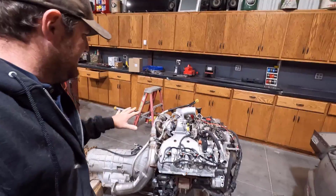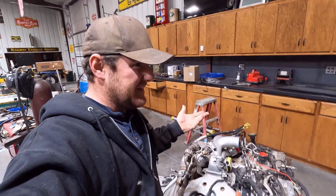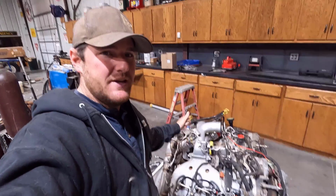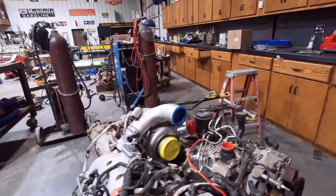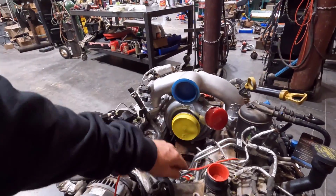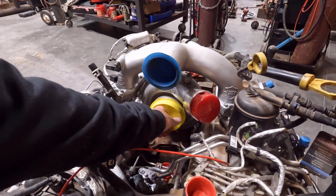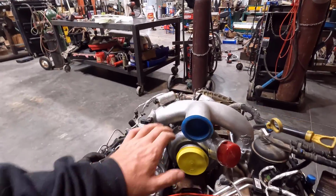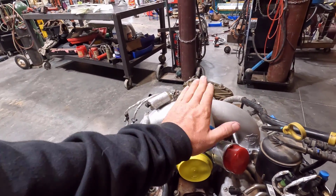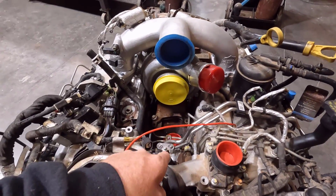And I need to finalize the turbo kit. We put a 2015 turbo kit on this truck because it was a cab and chassis truck, so it has a smaller turbo. And I put the Ford Performance kit for a 2015 and up style pickup truck turbo. So a bigger turbo, a little bit more power, more reliable as well. Those cab and chassis turbos have some problems. And I have an H&S intake manifold on here, just clean it up so we don't have that big plastic intake manifold here.